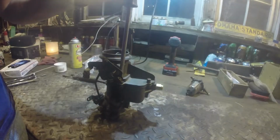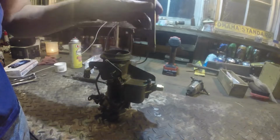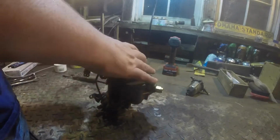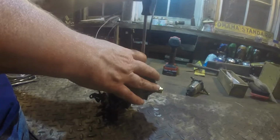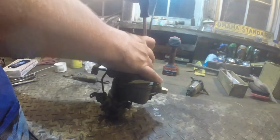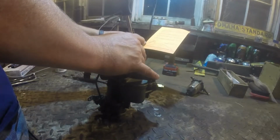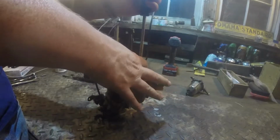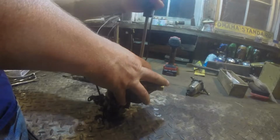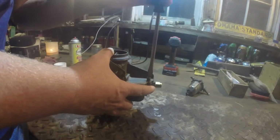Now I should adjust the float bowl, and I actually bent it up a little bit because I was trying to get more pressure onto the close off for the inlet. And so I thought, well, I'll bend it up. So it probably needs to go back down, but why wouldn't I check that while I was in there? He's got a little template for it. Cut out and assemble float gauge. Oh, that kind of gets a little too complicated for me. Maybe I should name my channel Measure Once, Cut Twice.